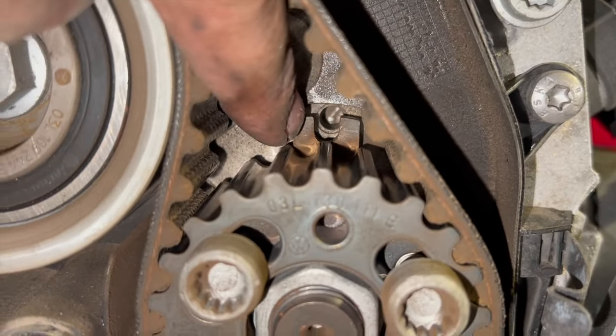So we'll just get the water pump off now, drop the coolant out. It's got all the bolts out for the pump now. They're not normally known for being too tight, these, but if you just grab the pump and just work it a bit, it should just drop straight out. So that's the water pump out. It doesn't actually feel in too bad a condition. The actual pulley feels okay. The actual spindle bit's on. Normally where they fail, sometimes they can fail on the spindle here, and the pump will be spinning, but the plastic piece broke off and they stop spinning.